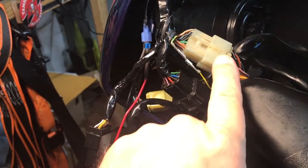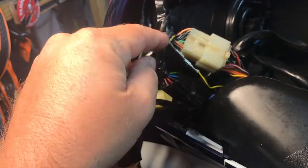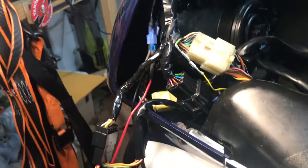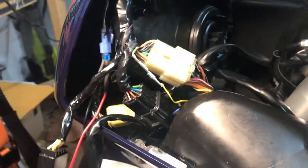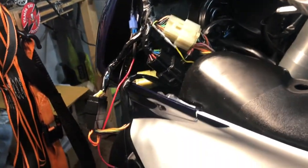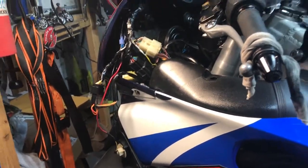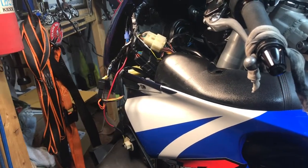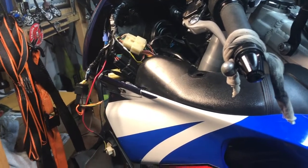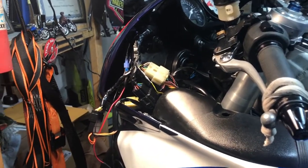So I think what it was is I pulled this connector apart. Before I pulled it apart, you grab the wires and pull them, and they moved somewhat. Nothing alarming, nothing really stuck out. So I pulled that connector apart and pulled the wires out, and then I just connected them together outside the plug and tried manipulating the wire bundle to see if I had the intermittent where it would cut in and cut out the starting button. And right now I can't get it to recreate the problem.